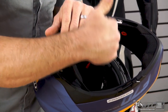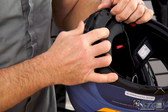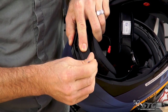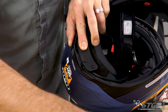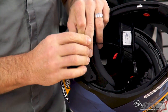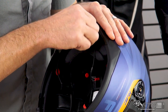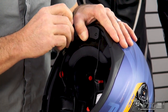Route the wires so that the speakers and the microphone harness are inside the helmet. Slide the unit into the pocket. Push down a little bit — you can see the threads for the threaded inserts that are going to retain this. Let's get the first one started and put the second one in. I'm putting a little bit of pressure on the unit itself so it's seated, and then I'll run these down. Once I have them all the way down, I'll put about another quarter turn on it to make sure the unit is secured.